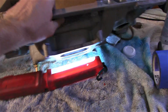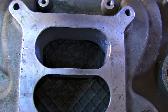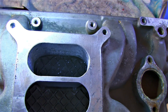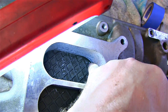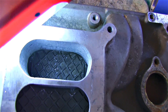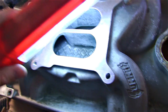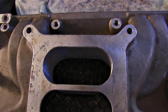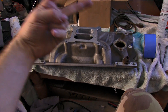Let's take one more look. In the intake you can see I've smoothed out the sides — this one had a bunch of bad casting marks and lumps in there. I just smoothed it out so the air goes more quickly and smoothly around the corner. Same thing here — bad casting, just cleaned it up to promote better atomization of the fuel and air into your engine. Anyway, that's it for the intake — hope you guys enjoyed it, peace out.